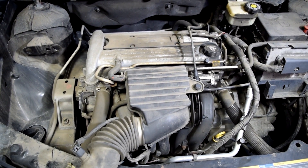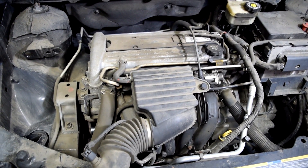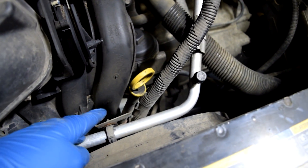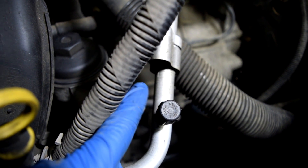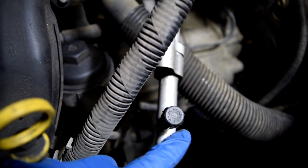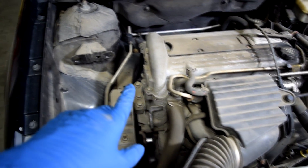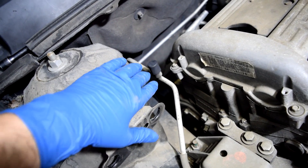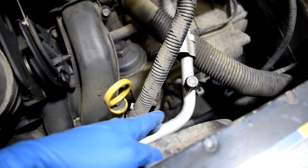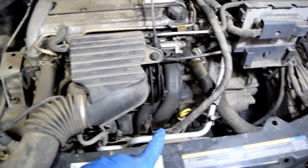Next we'll need to go over to the engine bay to find two things: first, the low pressure side and the fitting that goes over that line, and second, your AC compressor. Your AC pressure lines look like this — you're going to have a low side and a high side, and on each line you'll have a fitting. There's usually a plastic cap on them that says either H for high or L for low. If you don't see that cap, don't worry — the high pressure side is going to be the thinner line. This is the high pressure line, and this is the low pressure line — see how much bigger this one is compared to that one. If you just follow either of these lines, they'll go to your AC compressor.